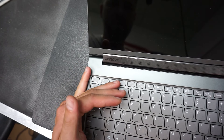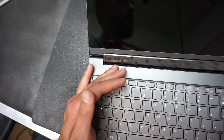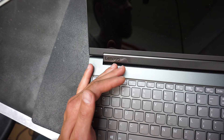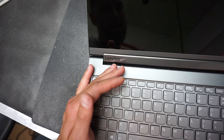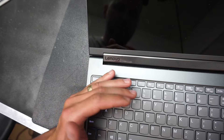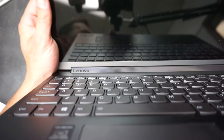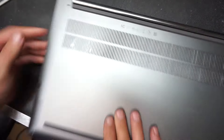I'm going to hold the power button until that Caps Lock light disappears. Hold down the power button for about 10-12 seconds. I'm keeping my hand back so you can see the Caps Lock. The backlight of the keyboard is on but nothing is on the screen. So yep, nothing works on this computer.